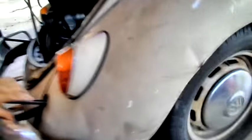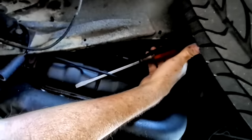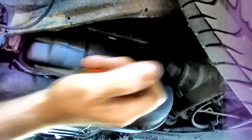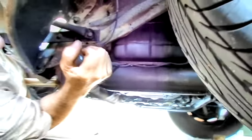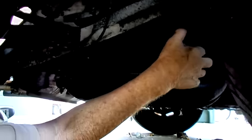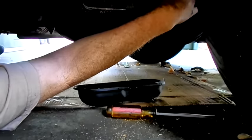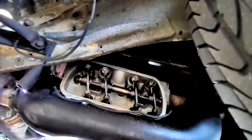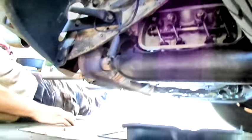The valve cover has a big heavy spring. This is where I put my screwdriver — just pull it down. That pops the spring down. Sometimes these little ones pop right off, sometimes not — you just have to kind of work them. And there it is.